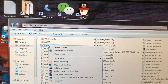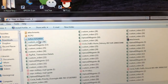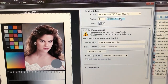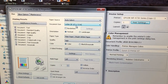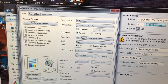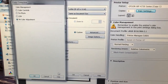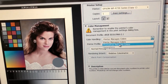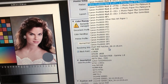For the final step, after downloading the profile, right-click on the profile and select Install. Now with the customized profile installed, we can let Photoshop manage the colors. We went into the printer's profile management and made sure to turn off the printer management — just to make sure the printer is not going to touch the color management. We can now select Photoshop to manage colors, and from the drop-down, select the customized ICC profile we just installed.